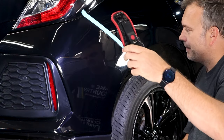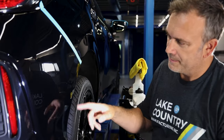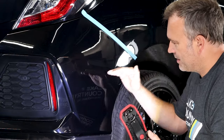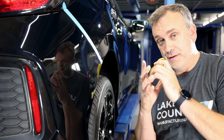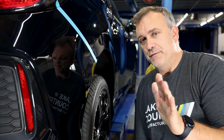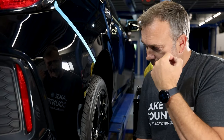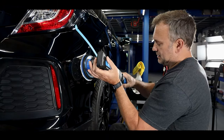It's a massive improvement - it's going to need another pass at least. I can see it's a lot glossier and now I've just got some random deeper marks. Remember, I've got the UDOS 51E which is very unique - I have the option to turn the mode up to P3 at 21mm, but just to prove to you that the microfiber has the ability to cut these away, I'm going to stick in P2 mode, and now this part should be even better.